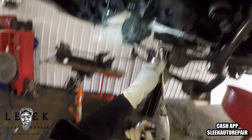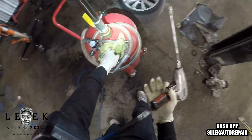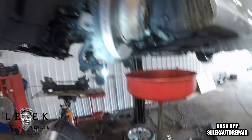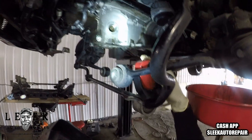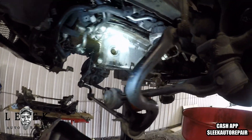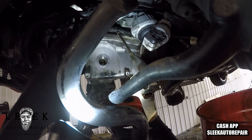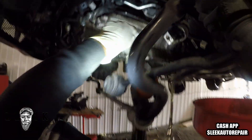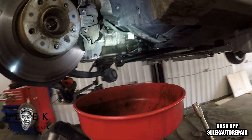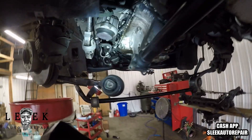I'm helping you save money. I did a job where suspension work was accessible since I had the suspension out already — you can do a bunch of things within this job. Suspension is one of them. You'll want an alignment after this too. This car didn't need an alignment because the steering shaft and rack were probably where they were supposed to be — you can mark those. But realistically, even if you don't think you need an alignment, just get the alignment.